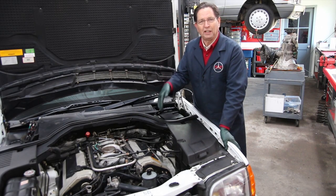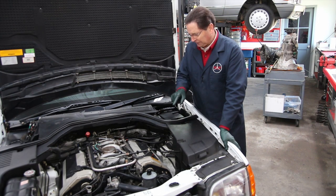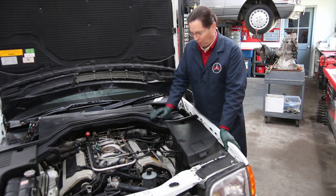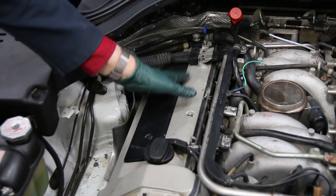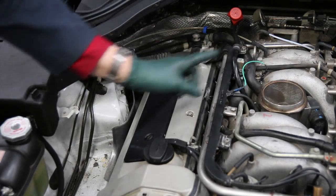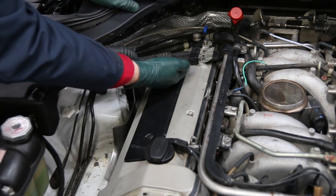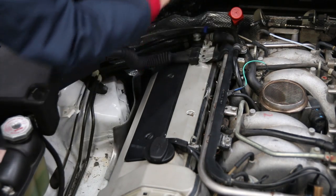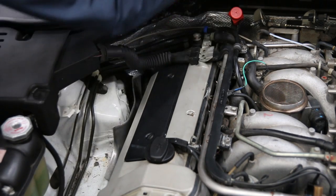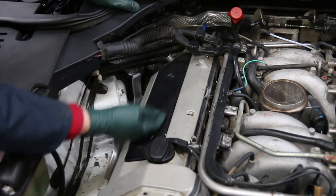I'm going to inspect the plugs in this M119 engine. It's not a difficult job — it's a simple job for the DIY mechanic. There are a few things to be concerned about, which I'll go over later in this video. Access is through the covers on top of the valve cover. I'll show the procedure on the right side of the engine. You have a wiring harness covering over the aft section of this plastic cover, which will also restrict you from moving the aft spark plug, so I'm going to remove this bracket to lift up the harness enough to get the cover off and get that rear plug out.